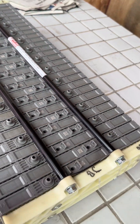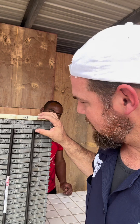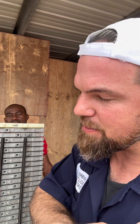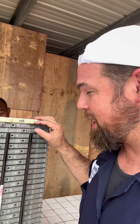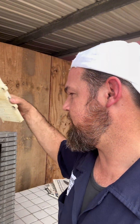This will help you get familiar with the unit in case you get confused. Pay very close attention to this super important characteristic when taking apart any high voltage Toyota battery: look at how much distance there is between the bolts and the frame — the level of swell in this battery is very high. A battery in good condition will match directly to the frame. If you see swelling of one, two, or even four blade-widths, it's garbage. Don't take any risk, especially when buying used. Swollen modules are gassing — they won't work.